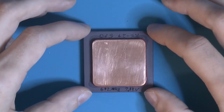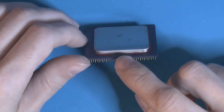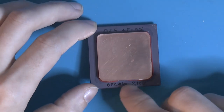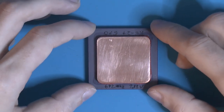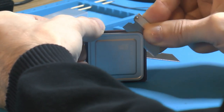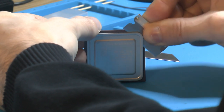I used that CPU to verify two boards working with K63 Pluses, and the modded ones gave a DRAM error on both. Once everything is protected and the liquid metal is applied, I glued the IHS on using silicone gasket sealant — probably not as strong as the original, but it's worked fine. I left a small opening because it's vinegar-based and I don't want corrosion on the inside, similar to what AMD does when they glue it on, to let gases escape during curing. It took me about eight days to bin three CPUs — I ran Prime 95 on each for 24 hours.